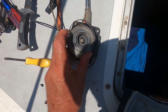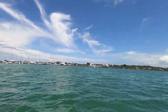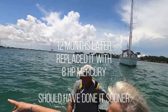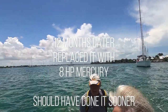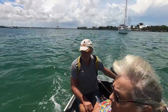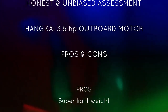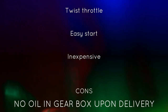And this is what flogged out the center of that. So we've got another six months out of Henkai before we had to retire it. She was a very noisy motor. We did have ongoing problems with that pull cord and with all of the rust around it. I think she would have been better suited for freshwater use as opposed to saltwater use. And maybe we should have paid the extra to get water-cooled as opposed to air-cooled, because it would have been nicer and quieter. We'll see you next time.